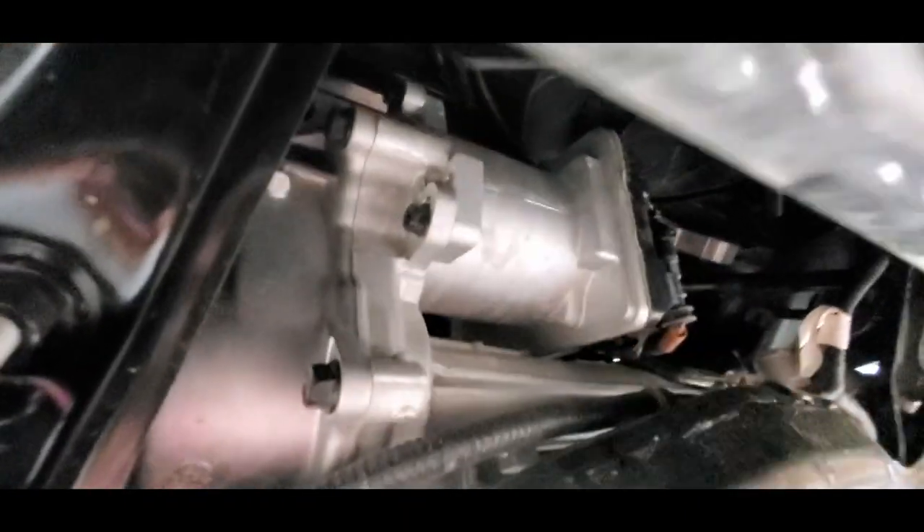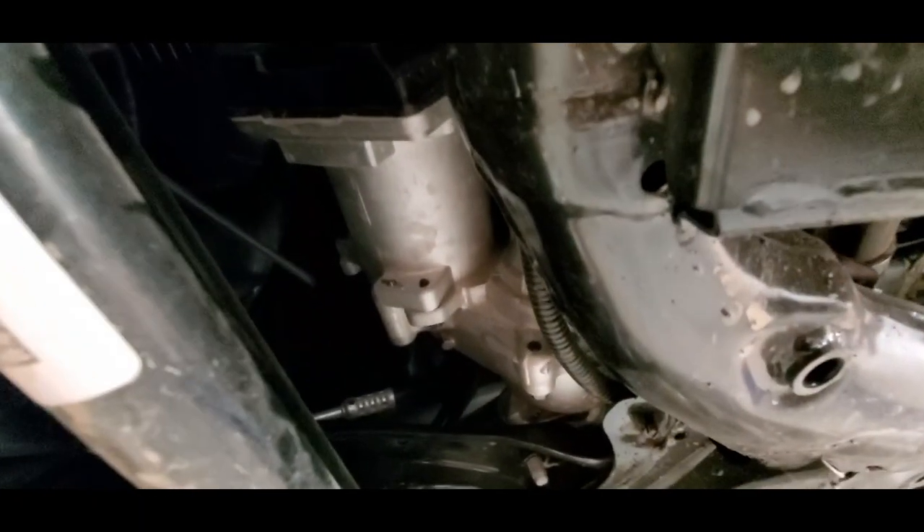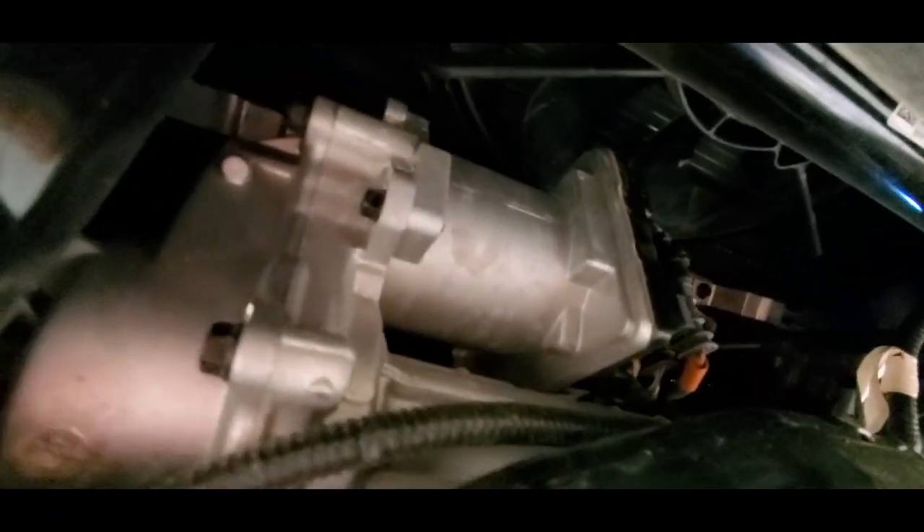So that's pretty much what's under here. Hopefully we can see more from the top. I almost missed this — this here has got to be some sort of electric motor to run a power steering assist. It's connected to this going all the way down to your tie rod. So that's got to be the power steering assist motor, and that'll be electric, not hydraulic.